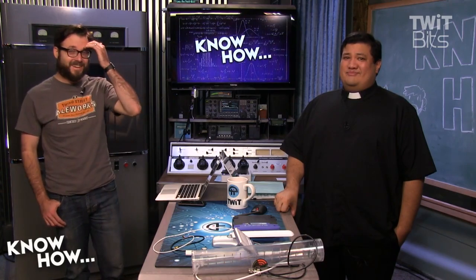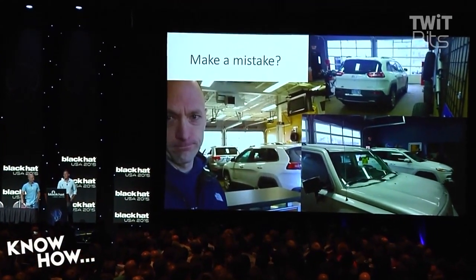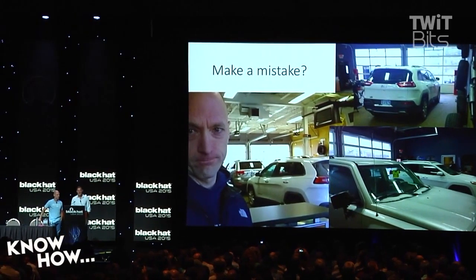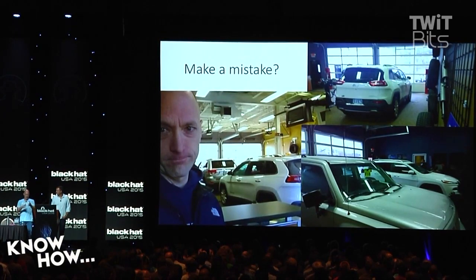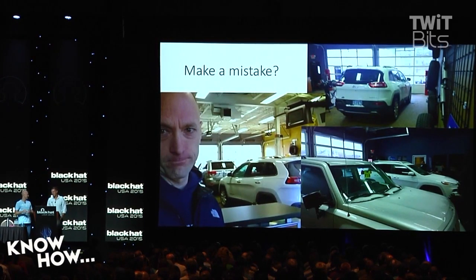Not really so much. You can have absolutely no idea what you're doing. Let's go ahead and make the feel-better — what happens when it goes wrong? This is sad, sad days. It was covered under warranty every time, which was the best part. One thing I'll say for Chrysler is they stand behind their products. Every time we would mess up — this happened twice — if you mess up flashing the V850, it just doesn't work anymore. The first time, I was flashing it and there was no output going on, so I didn't know what it was doing, and I just turned it off. It was half flashed and never came back on again. Don't do that. The real upgrade mechanism doesn't let you do that — it has safety. I have no safety.